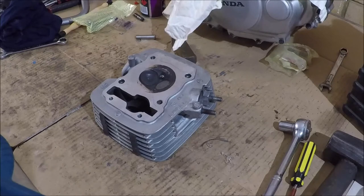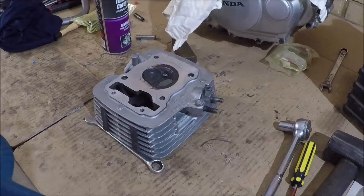If something's defective, I tend to put it to one side. There's the good pile and then there's the not so good pile. This came from the good pile. But what I'd like to do with it today is put new valves in it and check to make sure that the seats are correct. By correct I mean that they're not pitted, damaged or anything like that, and that they're serviceable and will provide a good seal for the valves.